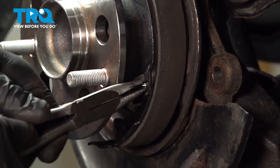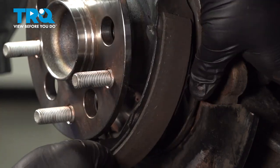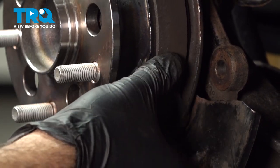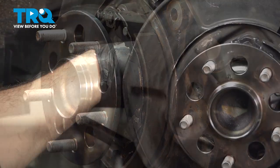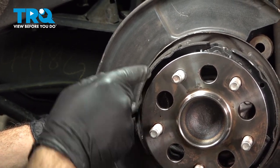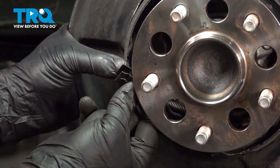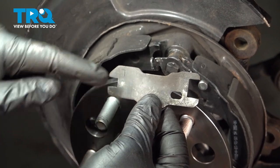Make sure that that post is locked in — it might take you a couple tries to get it. Now we have this shoe stabilized. Go ahead and install the forward shoe. Put our pin in from the back, making sure the notch on the top of the shoe fits onto the post. Repeat the same process we did for the other side — put our spring clip on and install the upper brace here. Thin side going towards the front, wide towards the rear.